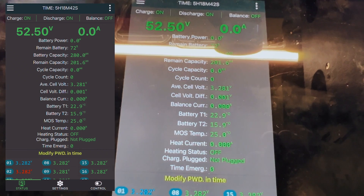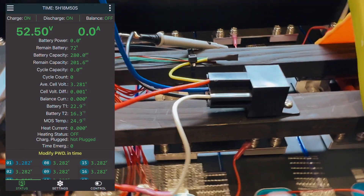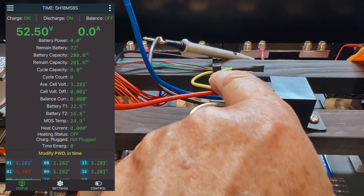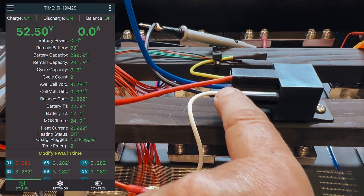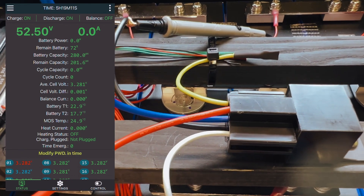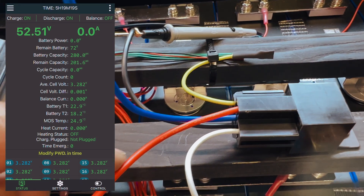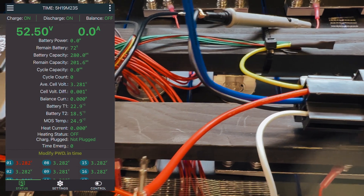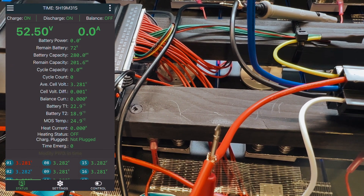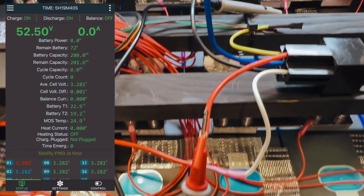The T2 temperature rose rapidly again once the ice was removed. The 48V relay means the activation coil — pins 85 and 86, the yellow and white cables — must be driven at 48V. However, you can connect anything to the black and red wires through the relay. In our case we're connecting 12V heating pads using a Victron 48-to-12 converter to drive the load through the relay.